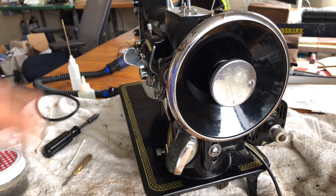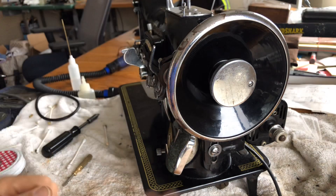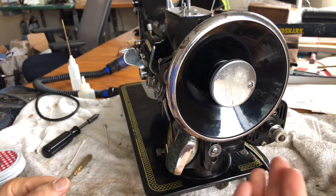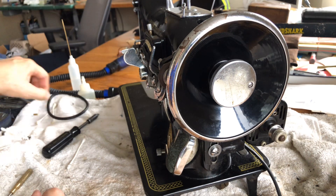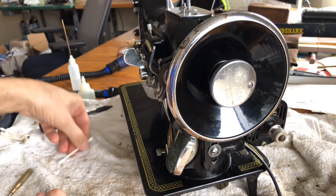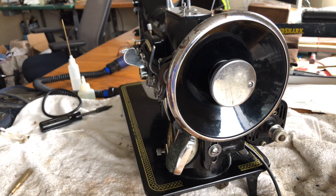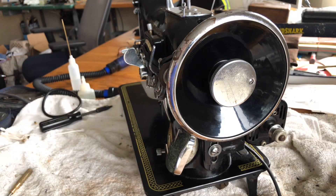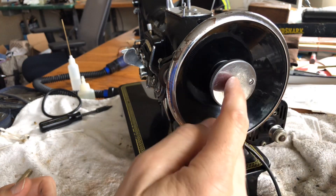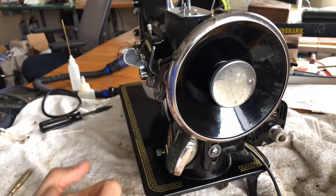And there you go — that's basically your hand wheel removing and checking for any problems with thread and dirt, and then just lubricating it, so that the next time it needs to come off — maybe because of a belt change — it's going to come off easily. A lot of your machines can be hard to disassemble sometimes simply because they've been sitting for a very long time. Now that I've done this lubricating on the hand wheel, that's going to take care of it for quite a long time. The more you sew, you don't necessarily have to keep oiling this every time you sew a project — that's different than the other oiling points on the machine. So that's a video about hand wheel and clutch knob removal and lubrication.